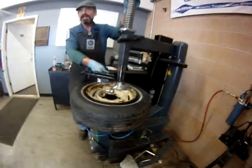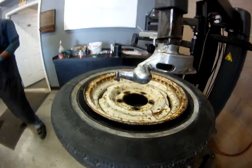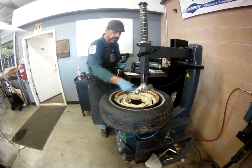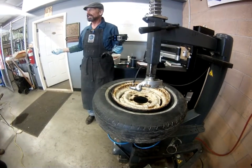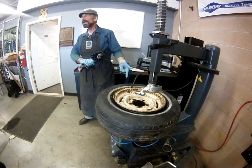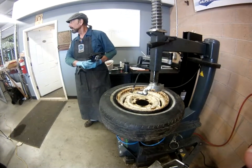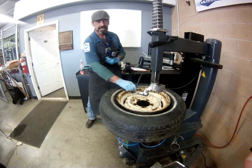I hope you all can see the duck head — that's why we call it the duck head. And today that is our rim clamp lesson for today. I'm going to take this off after I fill it full of air. I'm going to fill it full of air with the Schrader valve removed. Why? Because it accepts air faster. And if there's a problem — if the rim's going to blow up, something's going to blow up, the tire's going to blow up — I can disconnect the air and walk away and it's going to get safer. If there's a Schrader valve in there, it's not only going to accept air slower, but if I have to get rid of the air and make it safer, it's not going to happen. I'd have to stand back 50 feet and shoot at the tire, or poke it with a lance 50 feet away. I just want to disconnect it right here and call it a day.